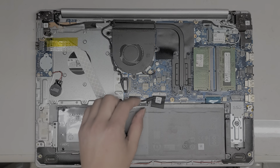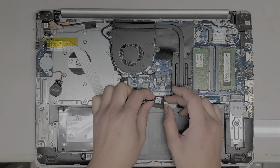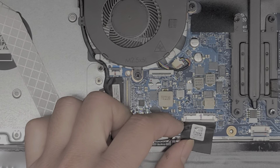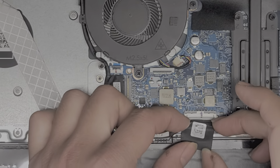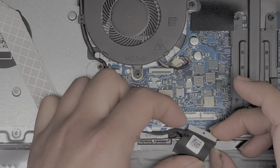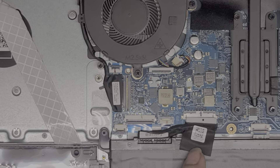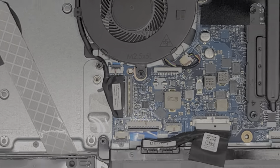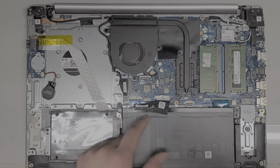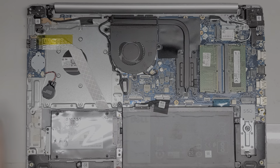I already disconnected the keyboard, but the battery — to remove it, there are little wings here. You can grab it and wiggle it, and pull the battery out. If you can't get a good grip, you can remove the battery first and it'll make it easier, giving you some room to pull the slack away.